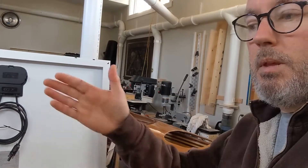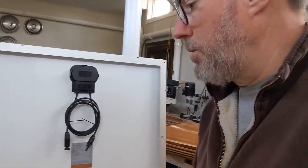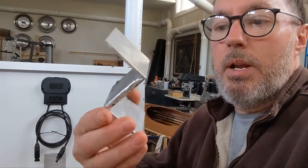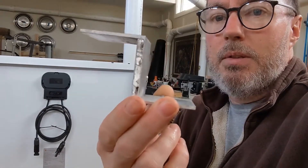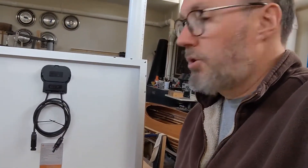My camper has cross members at 24 inches so we're gonna redrill those. When you buy these you can get a bracket kit to mount them, but I wasn't sure exactly how I was gonna mount them so I ended up making my own. I just took some aluminum angle, welded it up, made a Z out of it. I'll drill these out and put them exactly where I need them — should be pretty straightforward.